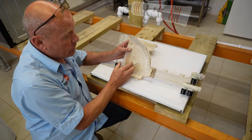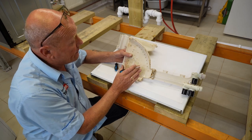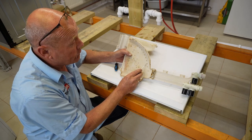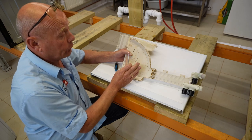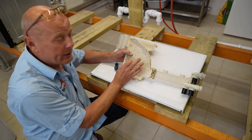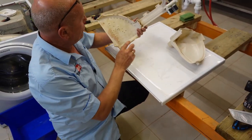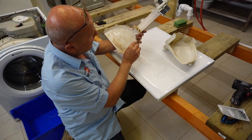This isn't a bad one, but on some machines if you're in a hard water area, the mineral content can build up so badly that it restricts the flow of water through these jets. You may have more water coming out of one jet than another, and this can also cause pressurization inside the soap drawer itself, which can cause it to leak around the outside.